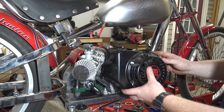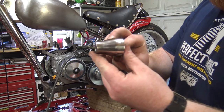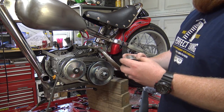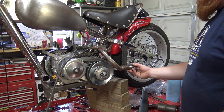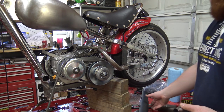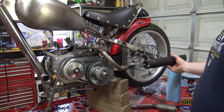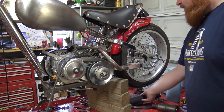Put the side cover back on — four bolts, two up top, two down bottom — and that part is done. The piece I was waiting for to finish the exhaust came in: a stainless steel one-inch to one-and-a-half-inch flange that I'll tack weld onto the end of the exhaust. That'll adapt up to the sleeve that goes inside the muffler. I'm going to hold everything up, line it up, tack it on, pull the header off, fully weld everything, and then make the exhaust hanger.